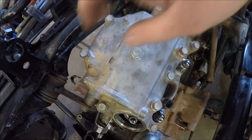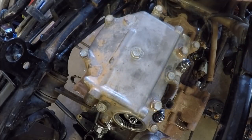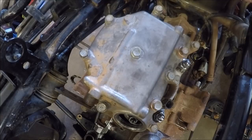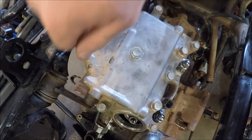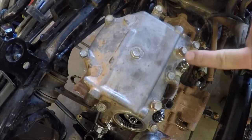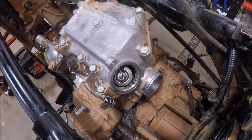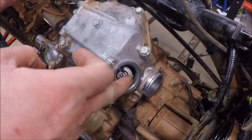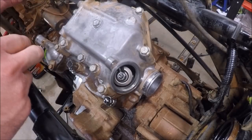There's no torque sequence or spec anywhere for this head, so I started from the inside and worked my way out multiple times. The torque spec is maybe nine or twelve foot-pounds — I don't want to tell you wrong, so I do it by feel with a quarter-inch wrench. Put new copper washers onto the two bolts. Now we're going to adjust the valves: the intake valve clearance needs to be six thousandths, and the exhaust needs to be nine thousandths.